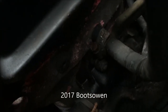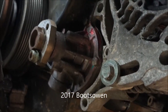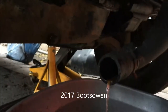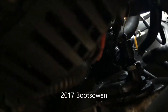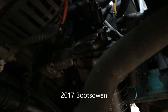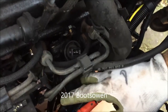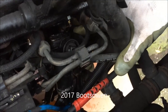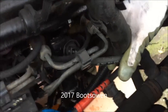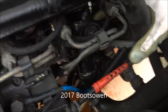You can see some pink staining here on the side of the cylinder head, and underneath on the water pump you can see some pink staining as well — that's a good indication that there are leaks coming out there. When the engine wasn't running and when it was laid up, the drips were all coming from the top of the oil filter just there. You can see the drip coming down, and I think that's coming from that manifold, so I'm going to swap it out. I've disconnected it from the hose at the front and the two connectors on the sides. Just behind there you can see the last glow plug on the right, and I've disconnected the strap cable on that because I think I'm going to need that off to get it out.